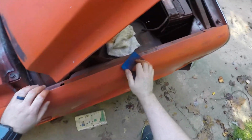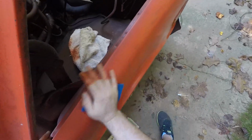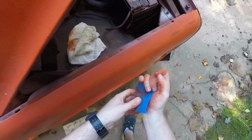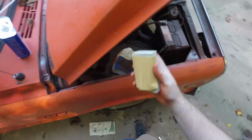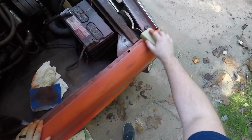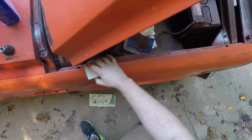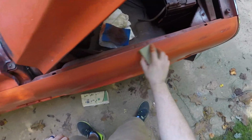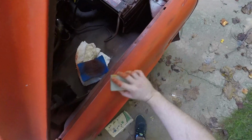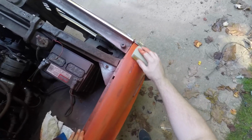Probably could sand it. If you had the right grit and didn't have a lot of pressure on there, you could for sure sand a little bit of this off. All right, we're back. This is 80, so we're gonna be really gentle with it. It's just scratching, but it's doing just enough. Could help us. This paint's also softened up too from the acetone.